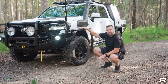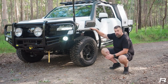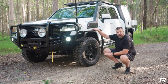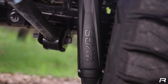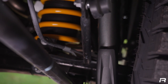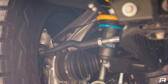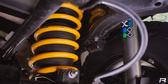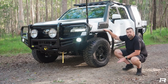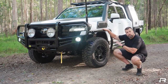With any of our builds, suspension plays a massive part in how the vehicle rides and how it controls the load. A GVM upgrade is always a necessity on the builds we do. On this one, being a dual cab conversion, the GVM upgrade is actually part of the conversion and the second stage manufacturing that ASG offer. ASG opted to work with TJM — a brand we do a fair bit with at Rambler as well. This particular 300 is fitted with their 4495 GVM upgrade, still maintaining the full three and a half ton towing. They do offer a 4200 as well, and both can be done on the wagon as well as the dual cab.